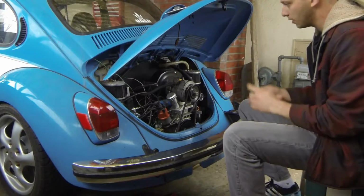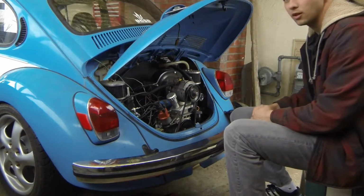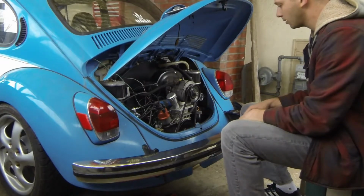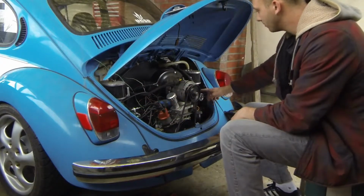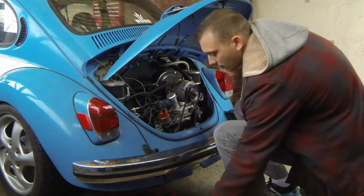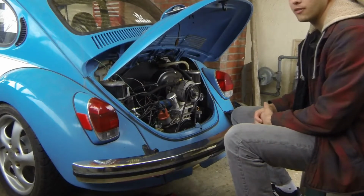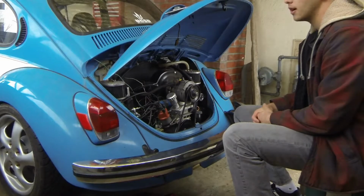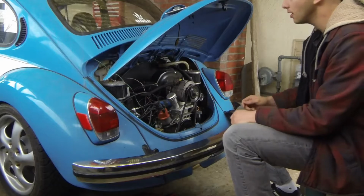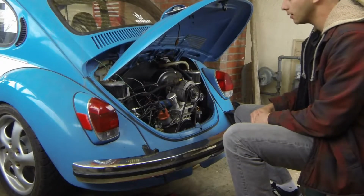DTM shroud, I have dual DRLA, I think they're 40s, carburetors, with a sync link cable adjustment, or cable linkage system. I highly recommend it. I messed with the crossbar all throughout having dual carburetors, and it was such a pain to get it to synchronize, or you think it looks good, but then when you start it up, it doesn't run good.